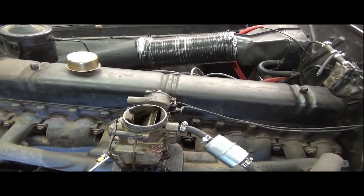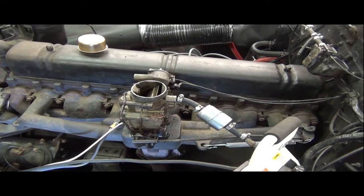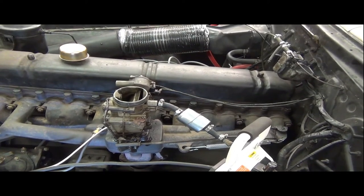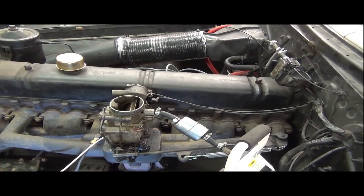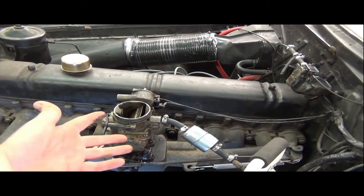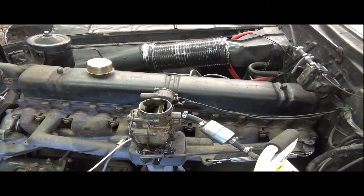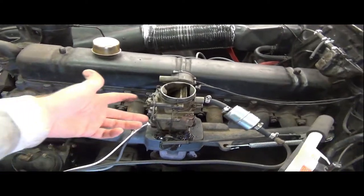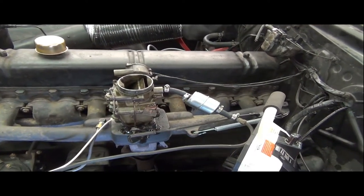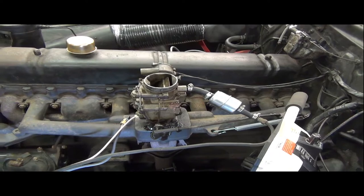It's a pretty interesting little carburetor. Most of the important parts that you can't see in there do the cool functions, which is providing idle up to a certain point. Then you've got a second setting, which is just more when you're getting better vacuum through the air horn. And then there's even a third, like above 70 mile an hour jet for just pumping raw fuel through. This guy here is a pumper, so that when you put your foot down on the gas, it provides one specific little extra charge of gas to help them run better.